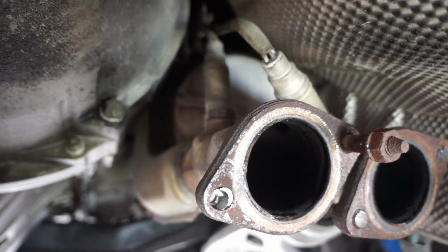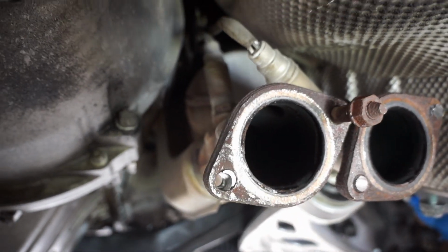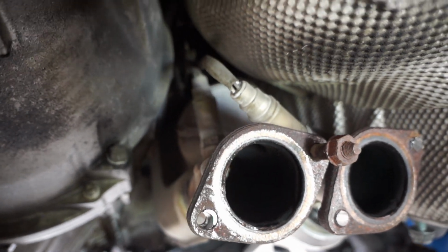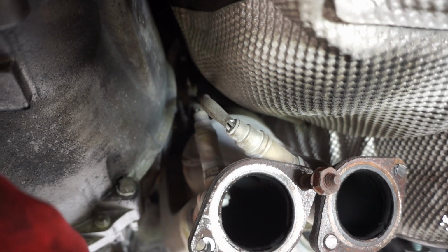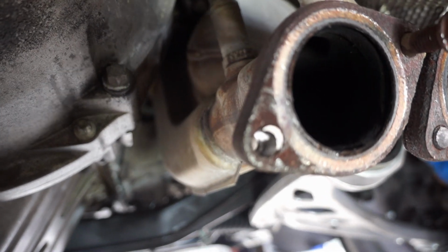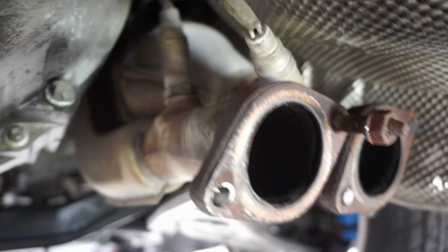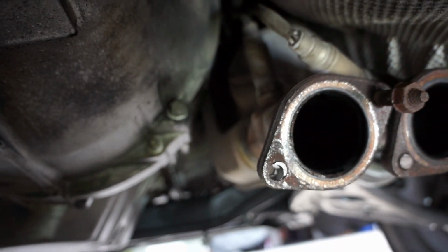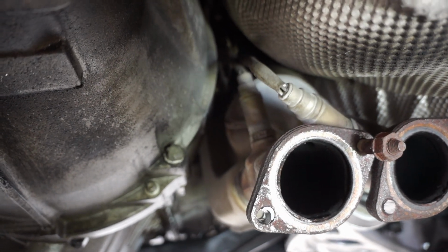Okay, you may need to use a couple different size drill bits, and as you can see, I wasn't completely centered, but once you get enough of it drilled out, you can use a mallet or something to hammer out the rest of it. I don't know if it'll come up if it's light enough back here, but you can see that the stud is starting to push out through the back. So it takes some time and some muscle, but eventually you'll get it to pop out.